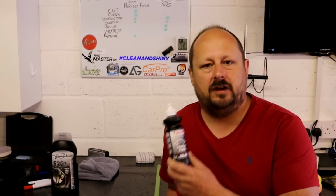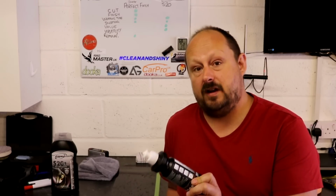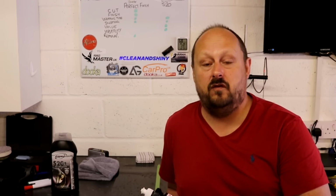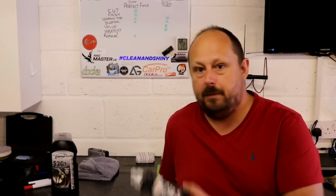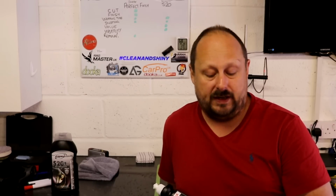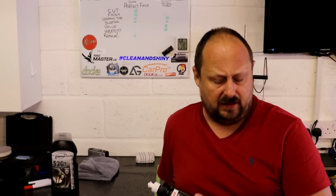Now, for me, this product comes alive on the rotary, where you can unlock the cut a little bit more. And you can unlock the cut very quickly at the start of the set with a bit of pressure, like they say, and you can take out heavy sanding marks very rapidly, and then deliver that high gloss finish at the same time. You could do that with the S20 Black, but it just struggled to get as much out as this did using the same method. So you might just have to go a little bit longer with the S20 Black. As well as that performance difference, I think it's slightly better on removal than the S20 Black, but there's not much in it. It's still an easy product to deliver, but this is a little bit lighter. The carrier system is incredible, very clever.